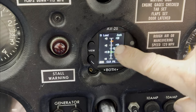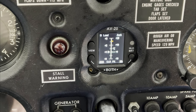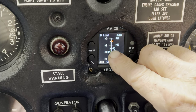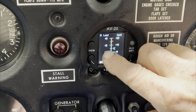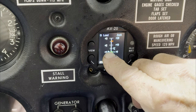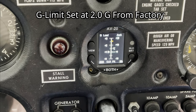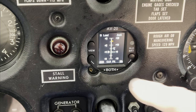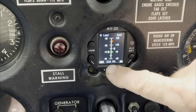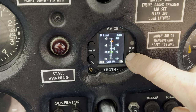Right now, the angle of attack limit — this red indicator to the right — is set by default at 15 degrees. The current angle of attack is shown by the little caret on the right-hand side. To the left is G-load, currently showing 1G. I don't remember what it comes set to at the factory, but I'll set that in the near future. You can clear the peak by pressing both buttons together — the peak is cleared. This is typically used when setting up your G-load and angle of attack limits, both low and high.